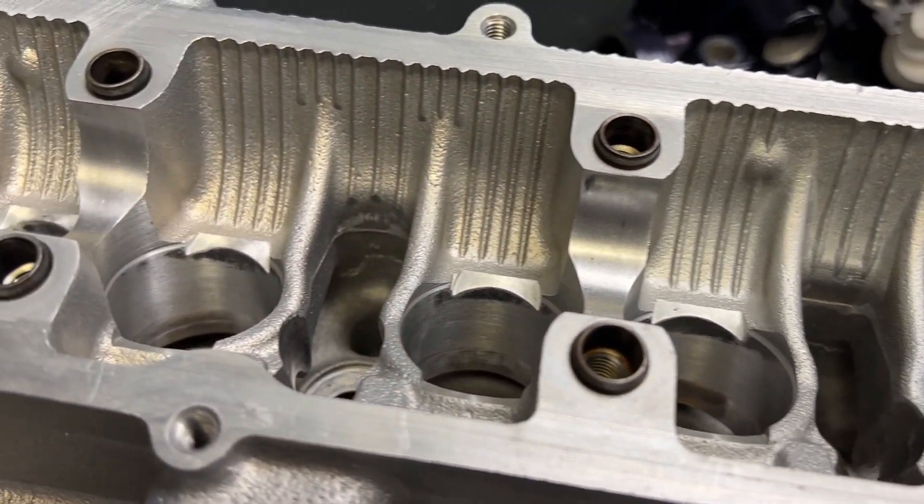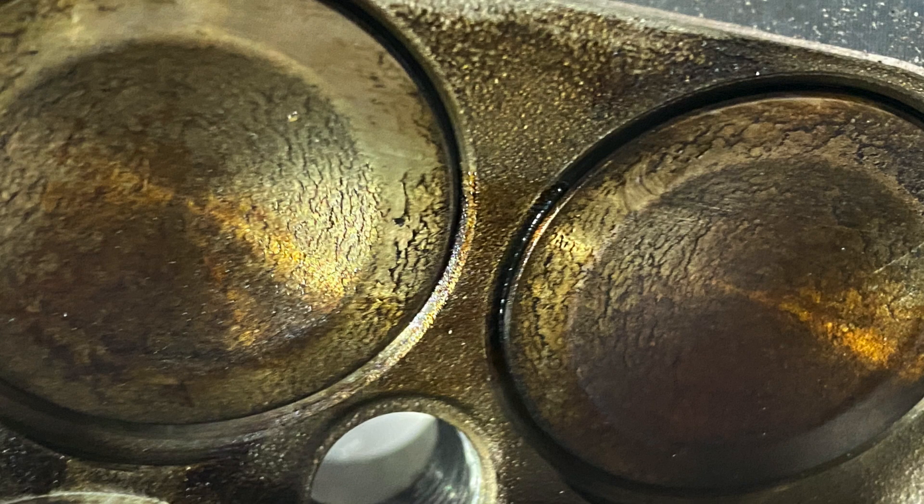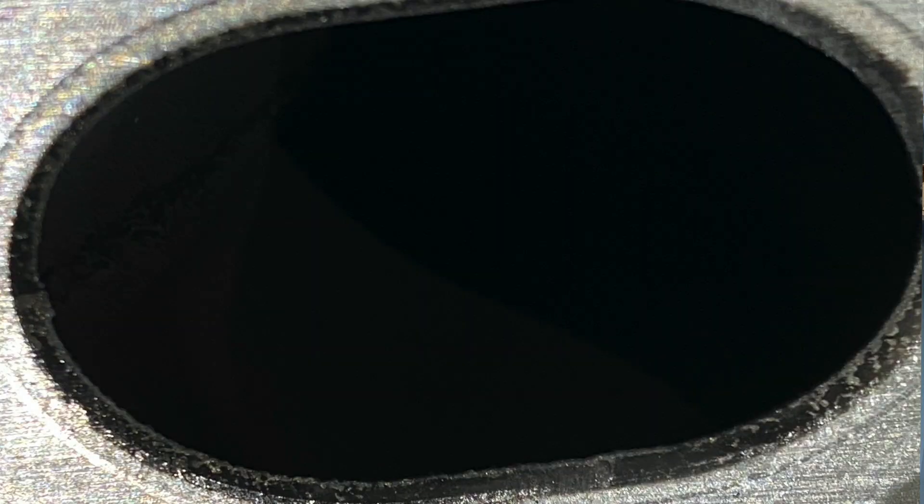Going a bit out of order here, but the first thing I noticed about Tom's head was that the combustion chamber, although it was oily, had a very light color to it — almost clean, but with oil kind of mixed in. That's when we figured out that has to be fuel; there's no other explanation. The intake port was completely clean, which it shouldn't be if the car ran correctly. And his exhaust ports were full of soot, so you could tell it was still burning and going through the exhaust port — the exhaust port was really black.